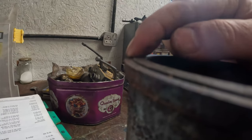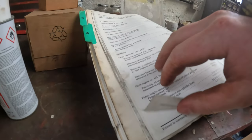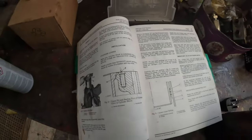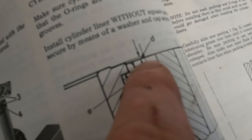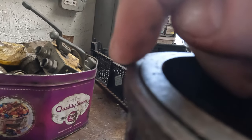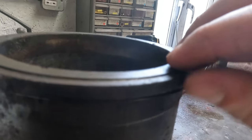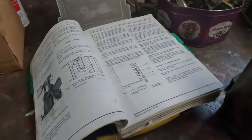So if we look here it's 0.02 to 0.10mm. It doesn't focus very well but that is the outer part of this lip and the block - that is what gap you need to measure. So we need to measure from the outer part of the lip to the block face. There's a ridge, and this shim will shim the gap up if it is too big basically.